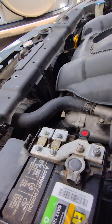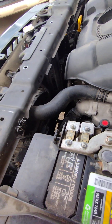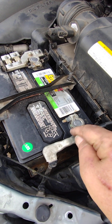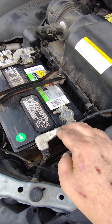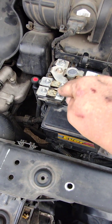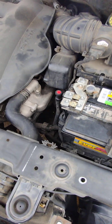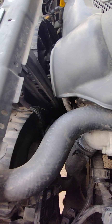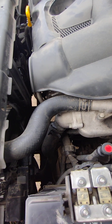We're testing it out — the fans are running; before they wouldn't run. I forgot to mention: before you do this job, disconnect the ground to the battery so you don't accidentally short anything out. You're going to be working in this area close to ground and could short out with your tool, so make sure you disconnect the battery. The fans are working and the compressor is not cycling — I believe she's fixed. Thanks for watching.